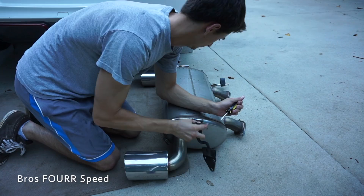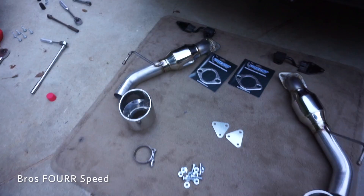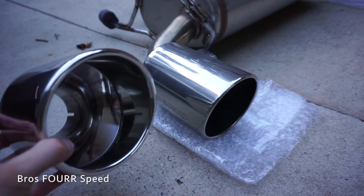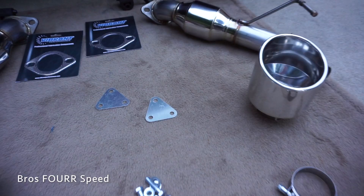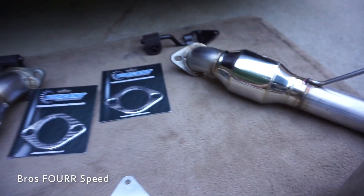All the removal is now complete — time for the install. We'll take a quick look at everything side by side. The stock one is in the 30-pound range; we save about 20 pounds going to the short tails. I've already placed the hangers in the same location as they were on the stock one. These tips look massive but are actually the same size, and you can get them not only polished but also in titanium blue. These two pieces are spacers — you can stack them or use one on each side. On my Red Z, I ended up using both on the passenger side, and that made them perfectly even.